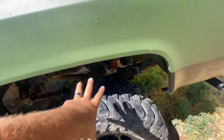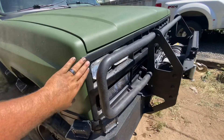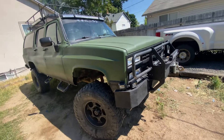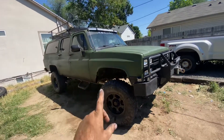The rear got new brake lines, 4.88 gears, and an ARB locker. Both front calipers were replaced — one had a bleeder that was rusted and starting to crumble when you tried to crack it, and the other was completely frozen. As for cosmetics — obviously there's this SteelIt primer I showed earlier. S-T-E-E-L-I-T. It sprays out amazing, it covers great, and we're going to see how durable it is over the next couple of weeks.